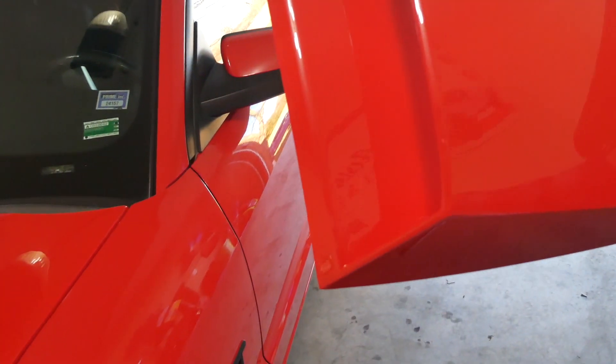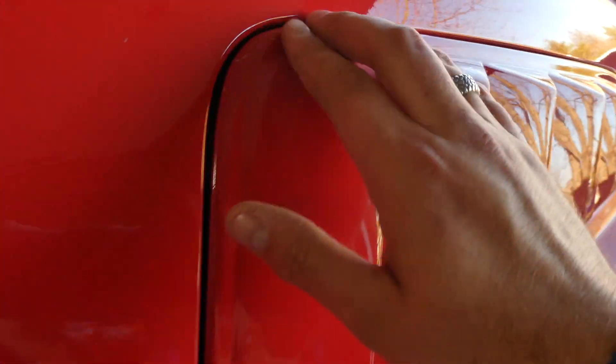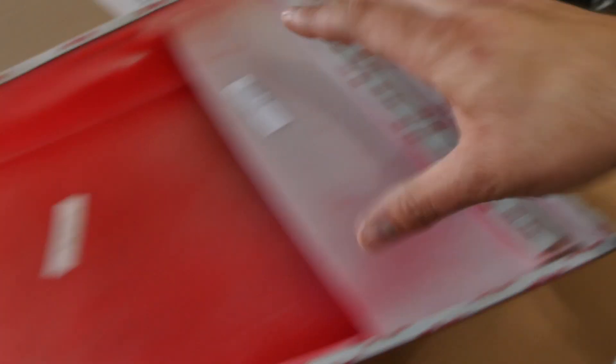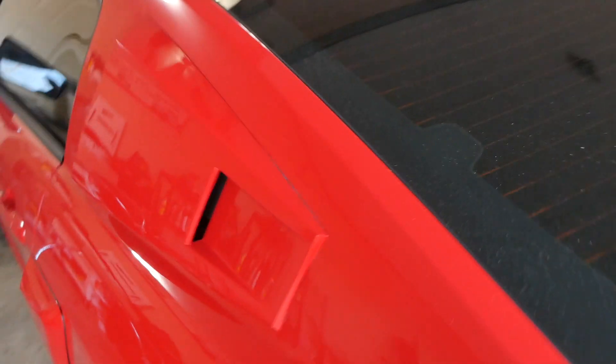This is the Eleanor style louver. We're going to take the supplied 3M tape strips and attach them to the back side of the louver. We'll heat gun the old louvers — the adhesive should release since they're just stuck to the actual glass with 3M tape. Old louvers are off, the area is cleaned, sticky residue is gone, and we've prepped it with an alcohol wipe. Then you peel and stick the new louvers on. They look great, especially paired with the brake scoop — nice little look.